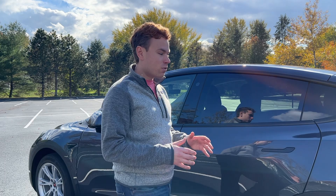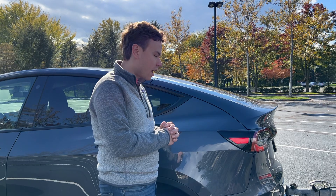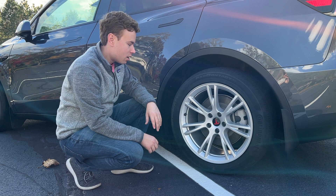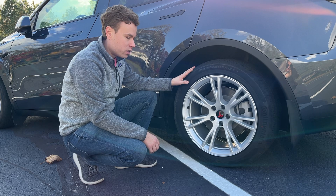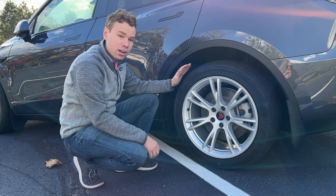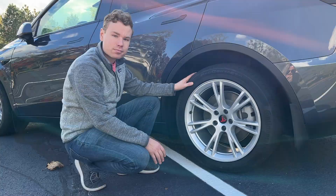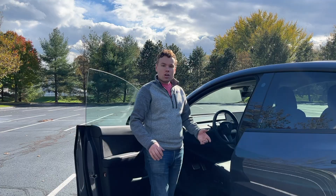There are certain maximums the car can tow and maximum hitch weight. If you intend to use the trailer hitch as an accessory like a bike rack or ski rack, that is rated for 160 pounds — and that includes the attachment itself. So if the attachment weighs 40 pounds, you have 120 pounds left for cargo like bikes. When towing with 19-inch wheels, the manual recommends 42 PSI on a cold tire — even driving a mile can affect PSI as tires heat up, so measure before you set off.